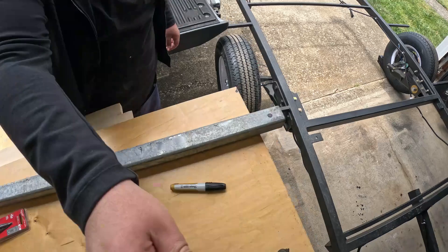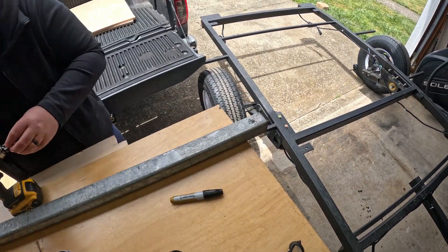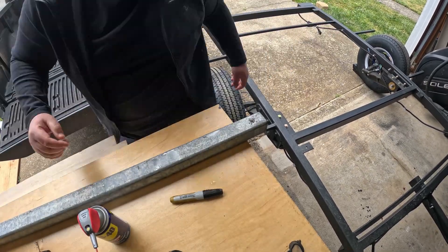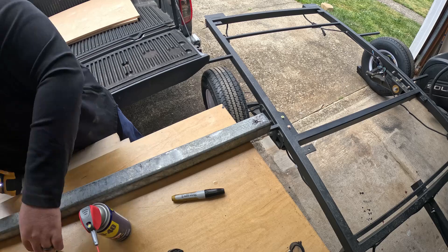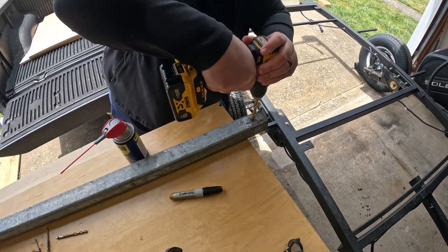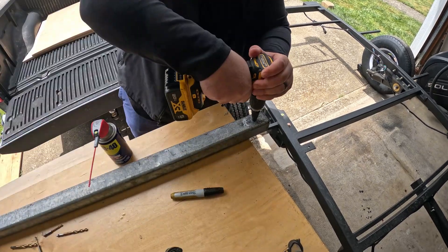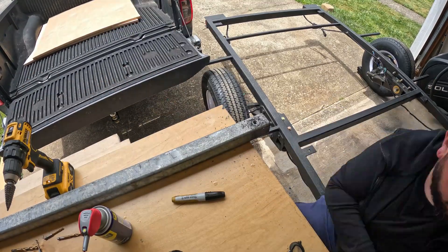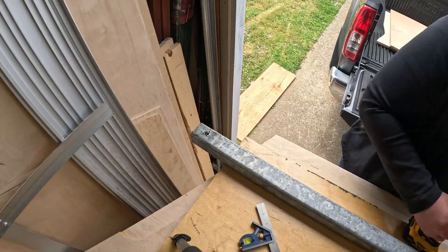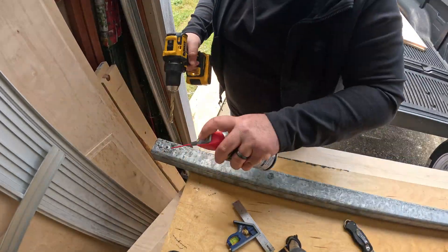This is a two by two quarter-inch thick steel beam that my buddy Carlo — who was in one of my other videos — he can get this from work and it was scrap there. So we cut it down in a shop to the right size and now I'm putting in screws so that we can attach it to the suspension with grade eight bolts. I'm putting the holes in first and then I'm going to use my flap disc to prep it for priming and truck bed lining.